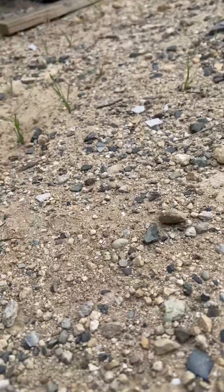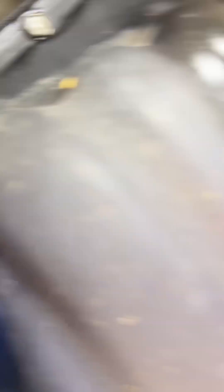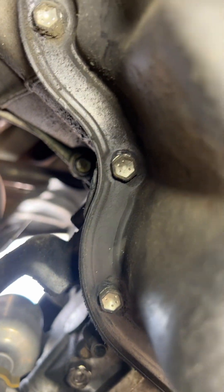Make sure your car is high enough on the jack stands. As you can see, this is the oil pan here. First things first, we're going to take off this drain bolt to drain out all the oil. After that, we're going to unbolt all the screws around the oil pan.